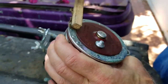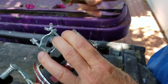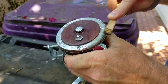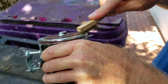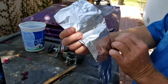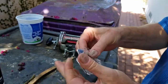We're just doing the chrome on one side here so we can compare it to the other side. Next thing we can do is use aluminum foil and water. Aluminum is softer than chrome so it won't scratch it either, and it'll shine it up — it forms an aluminum oxide that will actually remove some more of the rusty oxidation. Here's our aluminum foil, just get this from your house.